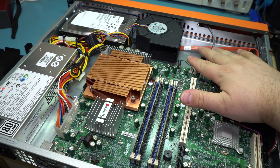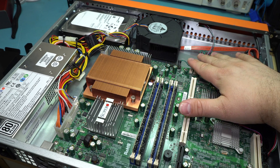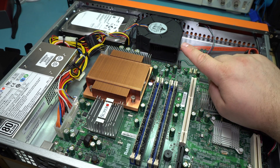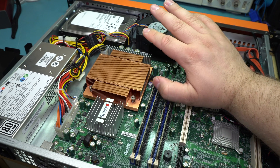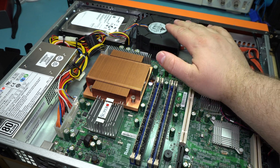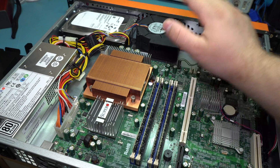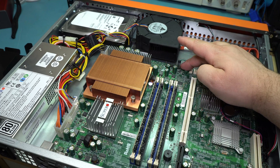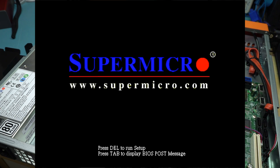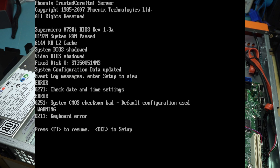When I got this, it did not power on automatically. There seems to be something wrong — maybe these connectors got moved, or the front panel display is just not set up properly, because it just does not power on. You have to short the pins on the motherboard to simulate a power button. And other than that, it worked fine.